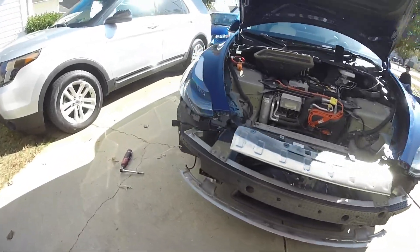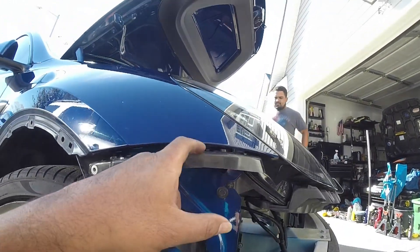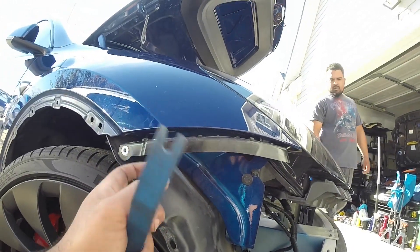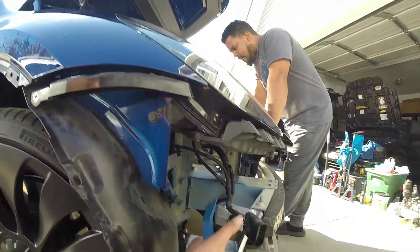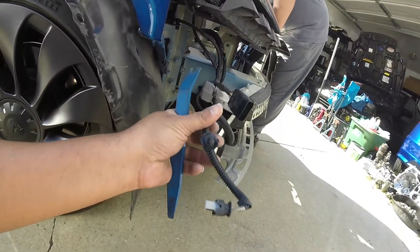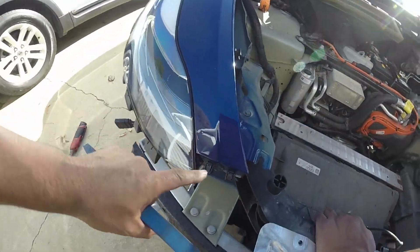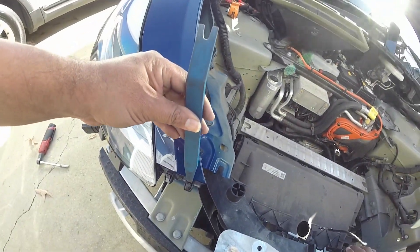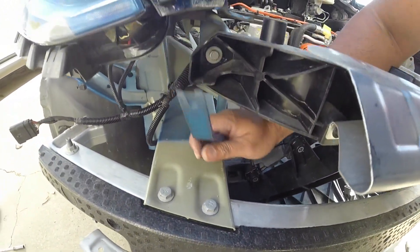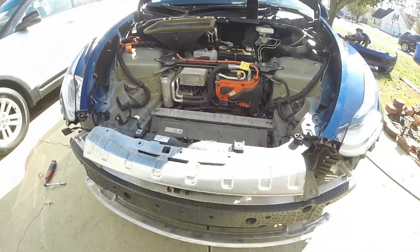Bumper's off. What we had to do was loosen these so they don't bite as hard on the bumper — we'll tie them back so reinstalling is a quick easy push. We loosened this so we wouldn't stress out the pins. We disconnected the bumper harness and the speaker. These clips were a little tight, so we went from the top and pushed down, then from the bottom and pushed up until they released, because we didn't want to break them.